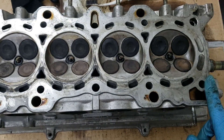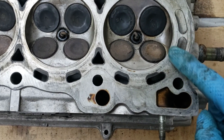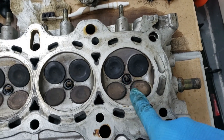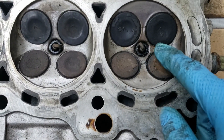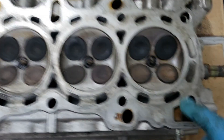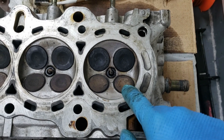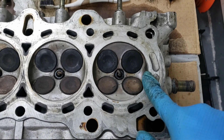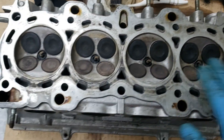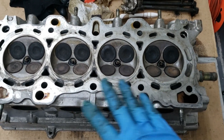I've wiped all the cylinders up. This one, cylinder four, still has some buildup on it. We were leaking when we did the leak down test in cylinder four. It looks like it's probably just a whole bunch of carbon and oil buildup - the valve still has this caked-on stuff, while the other valves look pretty okay. That's probably what's causing it to leak air - too much gummed up crap in here. We're going to continue cleaning this a bit more, spray some more carb cleaner on it, then dunk the head into the parts washer after removing the valves.